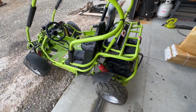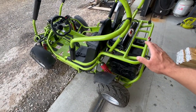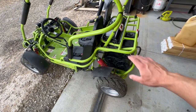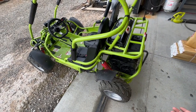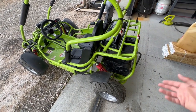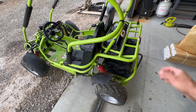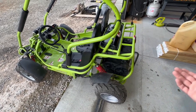Another important thing to check when you first get something like this is the engine oil and the gear oil. The engine oil was already filled but I didn't know if it was the correct weight or good quality, so I dumped it out and put in something I knew was quality. For break-in, I changed it every two to three hours because these engines have a lot of metal shavings in the oil the first few hours — and these things don't have filters. Do that a couple of times until the oil starts looking clean, then you can go to the regular 10-hour interval.